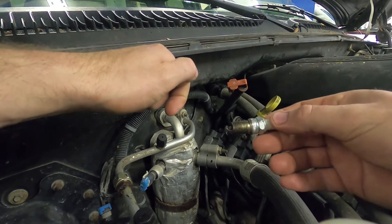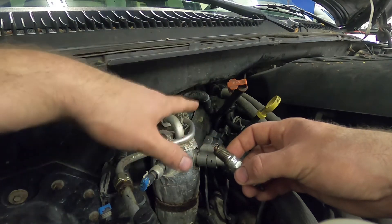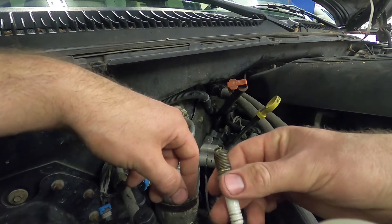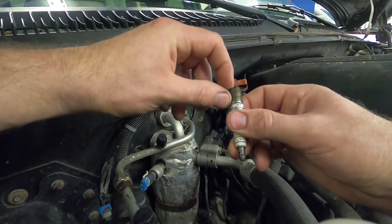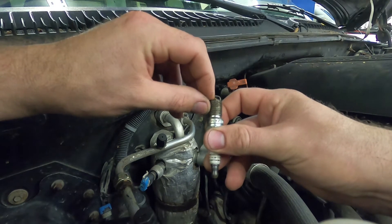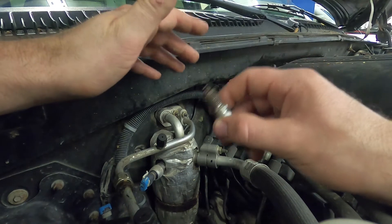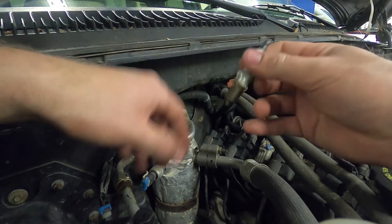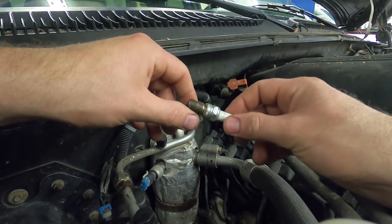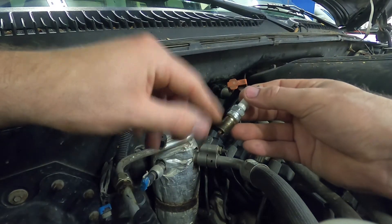The next thing I did was remove the spark plug. When it came out it was wet with gas, which means the injector is at least giving it fuel — I don't know if it's the proper amount, but it is giving it fuel. And if you look at this plug, this electrode is loose in the center. This plug is bad. I didn't see that before, but that makes me 100% confident. So it needs a spark plug — that's it. This porcelain here is moving around loose, which means it's probably arcing down inside the base, causing the misfire. The porcelain's not letting the arc jump properly — it's probably arcing inside the plug.